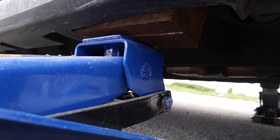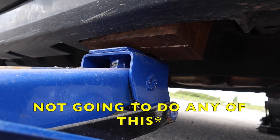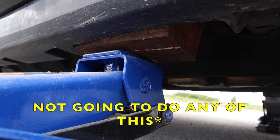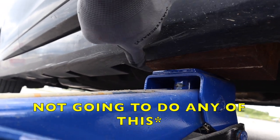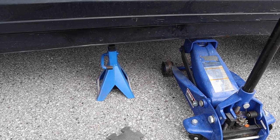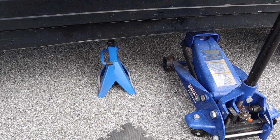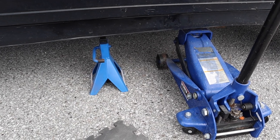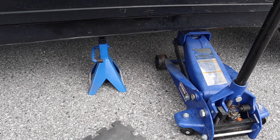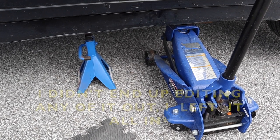So I'm going to, okay, I have enough experience that I'm gonna leave it this low. Okay, I lowered this side a bit. I started going too high, and that's where my problem started occurring. So I'm gonna do this, and I'm actually gonna set it down on the jack stand slot right there. Okay. All right, so I very gently, the slot at the front, you cannot put the jack stand into it because of where the jack is. So I put it on one a little bit further back, and even as I put it down just a hair, I could see it starting to chip the paint and wanting to bend. I stopped before that because I had the control on the floor jack, but no, this is not a DIY skirt cutout friendly car.